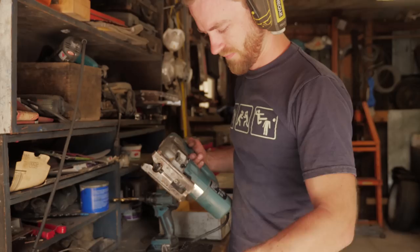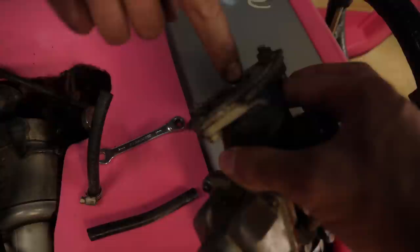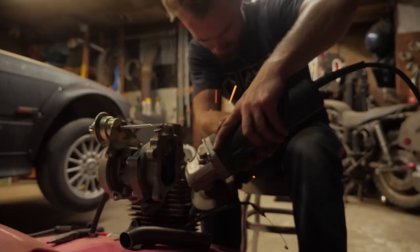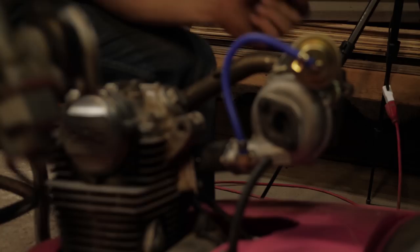That didn't work. I've been building lots and lots of flanges — a flange for the intake on the turbo, for the outlet, for the exhaust inlet. That flange is removable. I'll just tack it in place so it's the right angle, then take it off and weld it. It spaces out so that you can adapt from that bolt pattern to this bolt pattern. That way we can reuse the same boot thing to hold the carburetor on, which will allow it a little bit of movement. Every time I think this thing can't get any crazier — it's incredibly absurd.